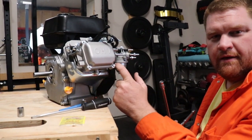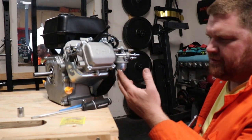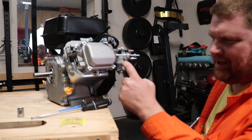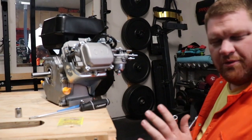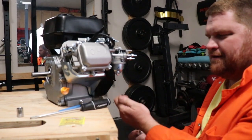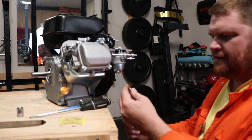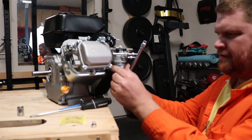There's a rubber O-ring up here that helps it seal. This is where you don't have to get real heavy handed — this is pot metal, cheap cast carburetor body. There's no reason to force anything here. Make sure when you're taking the screw out — lefty loosey. Do the rest by hand. It comes right out. It's not a long-winded bolt. Bolt comes out. We've never run this engine — it's got a clean bowl.